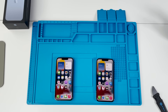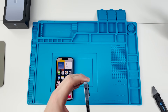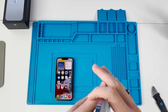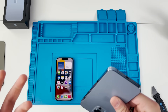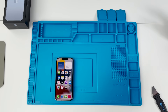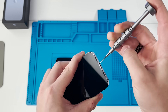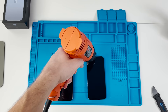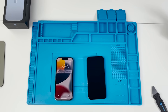We're now at the home screen, so it's time to open these up. Because this is a brand new phone I don't have any schematics or repair guides, so I just have to look around. Apple's pretty predictable — they've been using the same method for opening up the phone for a long time. There are two pentalobe screws at the bottom; we unscrew both of those, then apply some heat to the front of the phone to loosen up the adhesive.